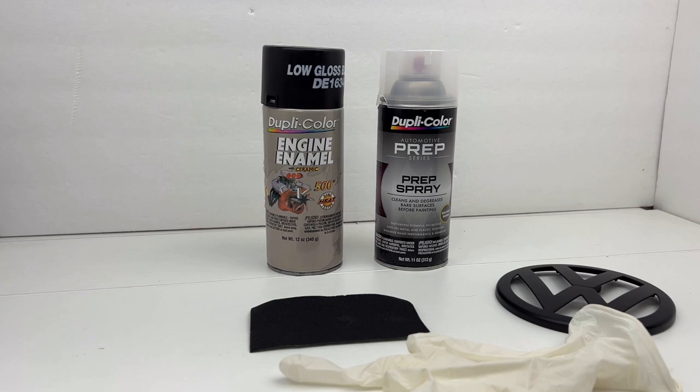When it comes to painting, you don't want to be painting when it's 20 degrees outside — you want it to be 60 degrees or better. A lot of times if I'm using a rattle can I'll put it in front of my small space heater to warm it up. You have to be careful doing that — you don't want to blow up a paint can — but I'll keep an eye on it. Paint flows better; everything works better if the paint is warm, if the surface you're painting is warm, if the outside temperature is warm. I don't paint in the rain and I don't paint when it's cold outside.